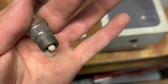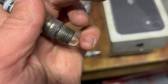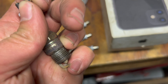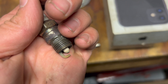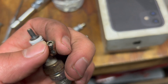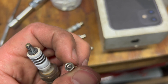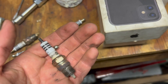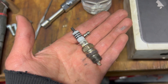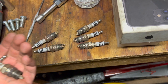I'm not sure if these necessarily fouled out - there should be a very fine tip on the inside part. I'll have to look more into that. I'm going to make sure these ends are nice and tight before the spark plug wire goes over top of them, because if they're a little loose maybe I'm getting some misfire. I've got the distributor cap with all the terminals cleaned off and I'm going to fire it up and see what it sounds like.